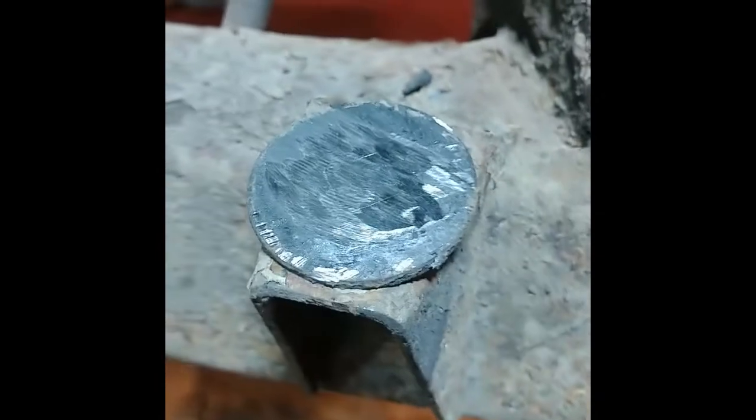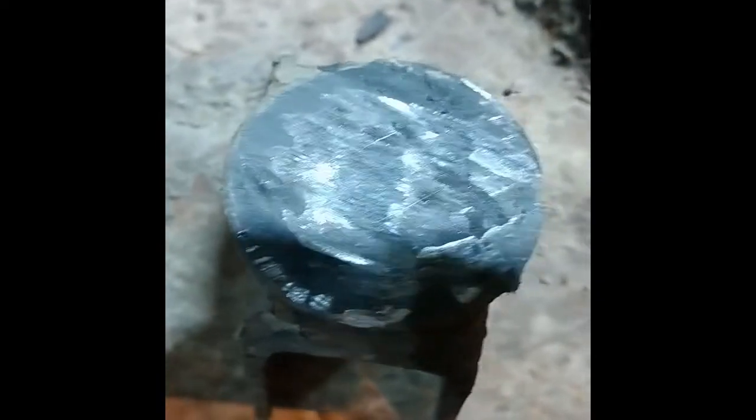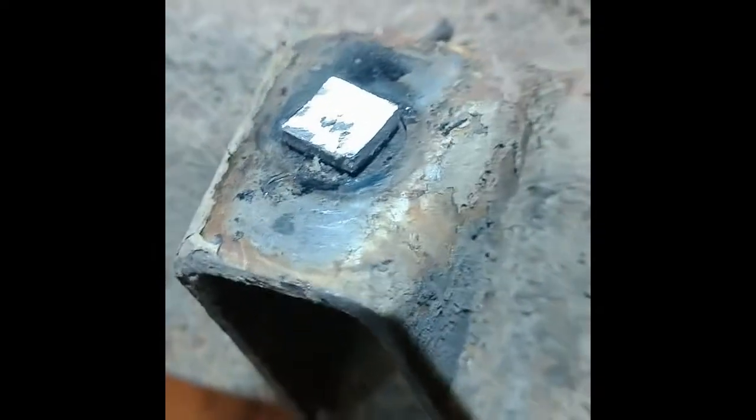Okay, ground it off. It smells really nice in here after heating up all that rubber. But I think I can see the outline of the bolt, so I should be able to punch it out now. Well, now I understand that's a captive nut down there. I should have just turned it off, but I should be able to grab that with a crescent wrench. Easy enough.